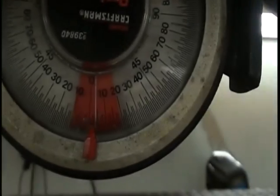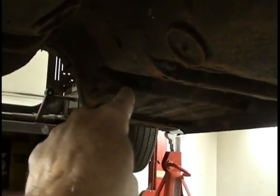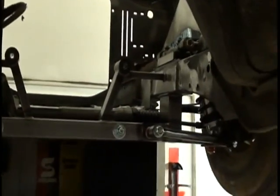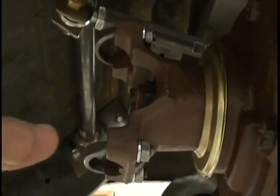Right now we have this car set up with the rocker panels level, the car sitting level. That means our engine stands that we put on the cross member are set at 4 degrees, so we will set with this 4-link, and it is just your discretion, but we set ours at 4 degrees. What we do is we set the pinion angle so the plane of the pinion runs uphill at the same plane that the transmission output shaft runs downhill. It'll be running 4 degrees downhill due to the inclination in our engine stands, which puts this 4 degrees uphill. What we're saying is we want to run it on the same plane. We do not want one down and one up. We want this one this way and the other one this way.